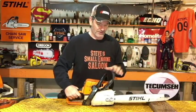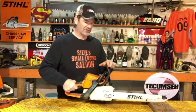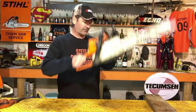I just went and tested 2 brand new saws right off the shelf. One Husqvarna and one Stihl. And I tried that drop down test with the bar on it. I already showed you that this one works with no bar and chain on it. Now watch this, bar's on it, and I'm going to drop that bar on the piece of wood. Chain brake's off right now. Chain brake's still off. Still off. Finally it came on. You've got to hit that thing really hard.